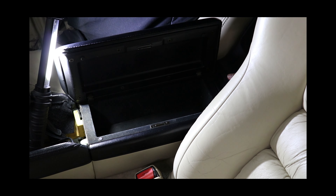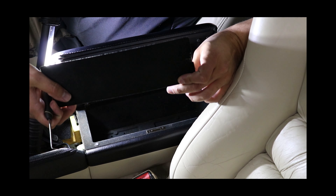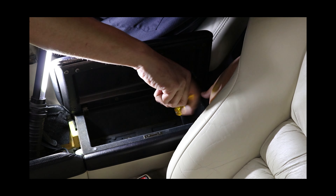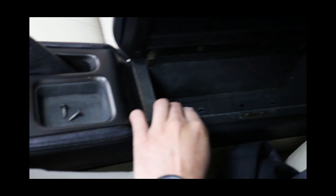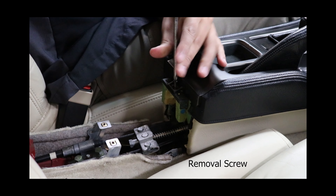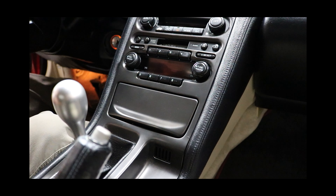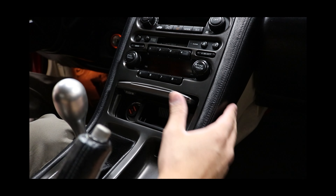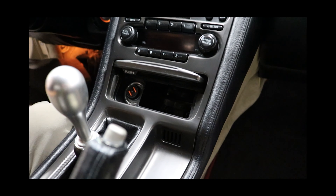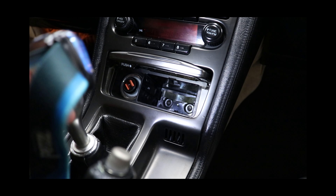The first thing we're going to do is remove this little floor from the compartment and then remove four screws inside here. Now that just comes right up. We're going to remove the ashtray because behind it there are some screws — lift up this compartment, push up, and the ashtray comes out. Behind there are two screws, so let's go ahead and take those out as well.